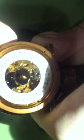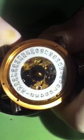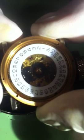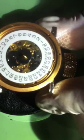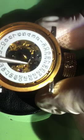Now we're going to get it into time set mode — that's snapped over. Go to the second position. Only set the date between three o'clock and nine o'clock — you don't want to set it anywhere close to midnight, between nine p.m. and three o'clock in the morning. You don't want to set it then, and that's what was happening — it was kind of hanging up when I was trying to do it earlier.